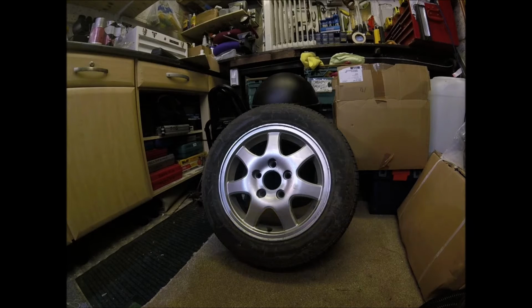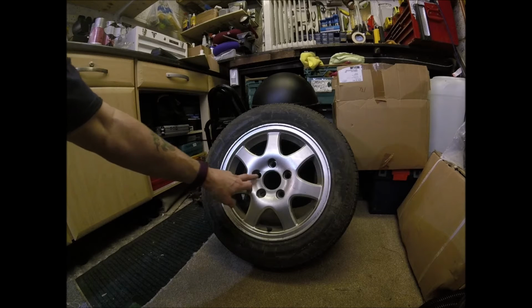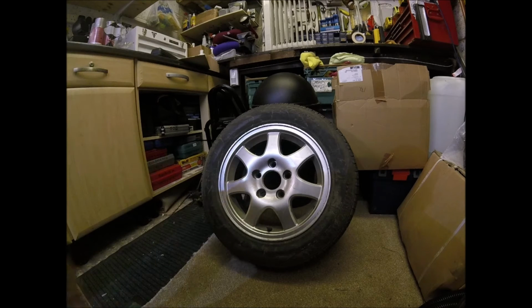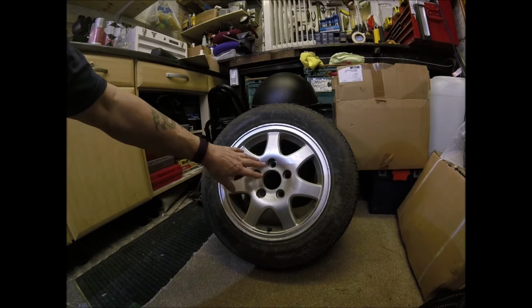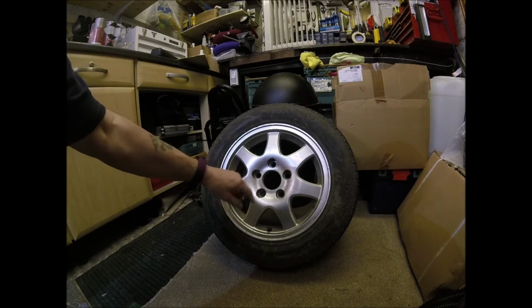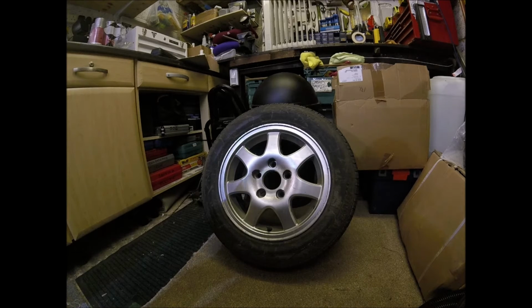So for cleaning, what I generally use is I kind of do a two-in-one cheat. Rather than just use soapy water, I use glass cleaner, because that will degrease at the same time. Now, you shouldn't get much grease around most of the rim, but you might get a little bit of grease around the bolt holes. In this case, I don't have studs on mine, I have bolts. And so if anybody else is kind of overzealous with copper grease and stuff like that on the drum to help stop the wheel from sticking, it can come through, and you only want the smallest amount of grease to have a crappy finish on your paint.